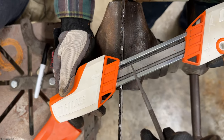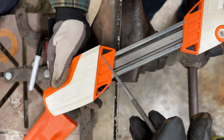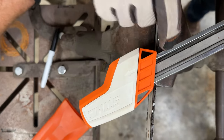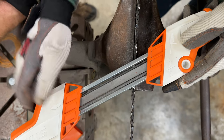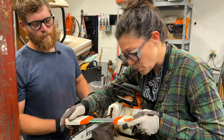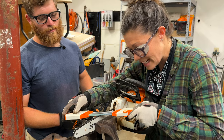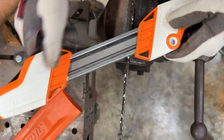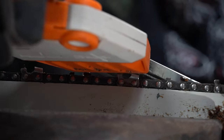The file cutting the tooth will be on the bottom, closest to the saw, and the arrow will be moving forward. So as we're setting this up, we know that the tooth this is engaged with right now is the one we want to cut. We are going to engage that on the side where the arrow is pointing. We need to keep this thing level — if you're going to err, err a little bit down, not up. These two railings ride on the chain right here and on this other tooth, so you literally cannot screw it up, which is fantastic.